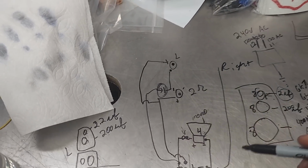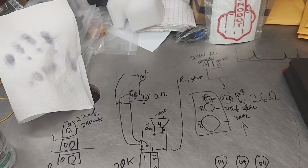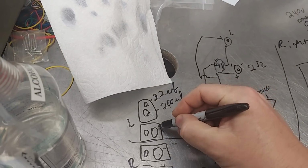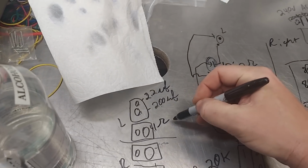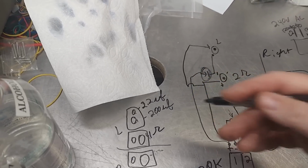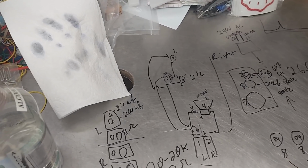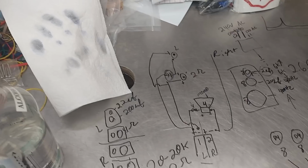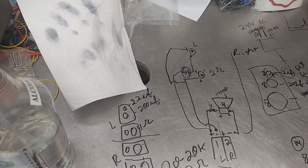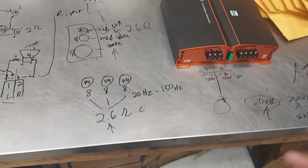And if you put 2 in series, that gives you 200 microfarad. Depending on your impedance, like in the case of these, this was a 4 ohm impedance, and when you put 2 in series, that gives you 200 microfarad, and that gives you a 6 dB slope at right around 400 hertz at 4 ohms. That's how that works. And if you wire capacitors in parallel, they double. But anyways, we'll get into that another time. Watch my LCR video. I'll put a link to it in the description.